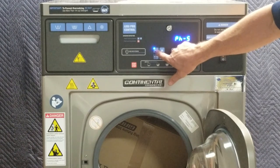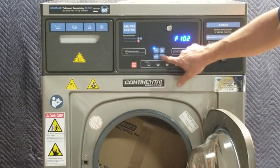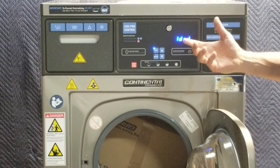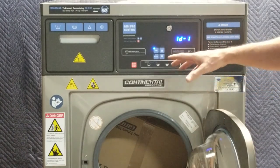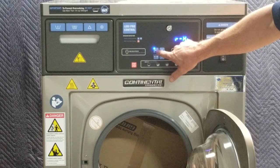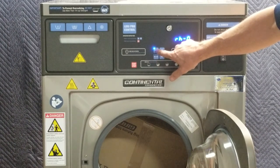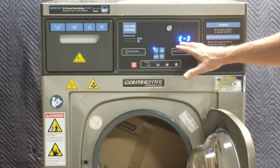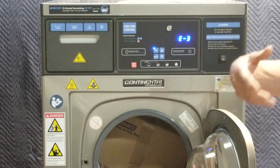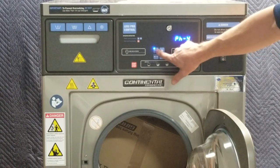Moving on: phase four is off, phase five is yes — turned on. Level three again — the highest. I'm going to select temperature down to 95. I'll leave dose one on; if it's really dirty you could have a second dose, but again 25 seconds, no second dose necessary. Agitation is high. Rotation time I'm going to set at 10 minutes for this heavy soil program. Rinse hold not necessary. For extract it's a good idea to go to three — that will rotate faster, take out some chemicals, and make rinsing better — and extract time at two.